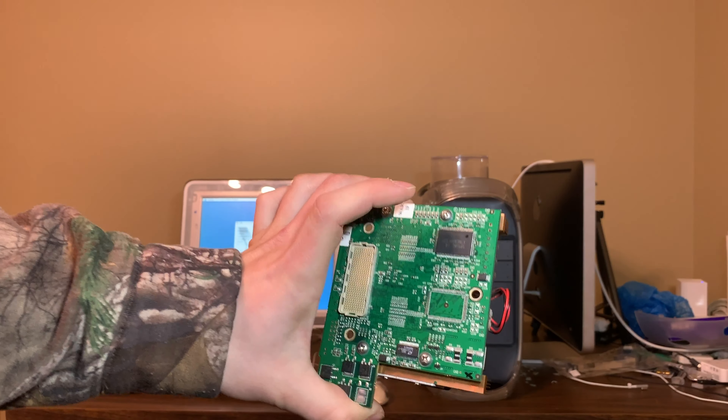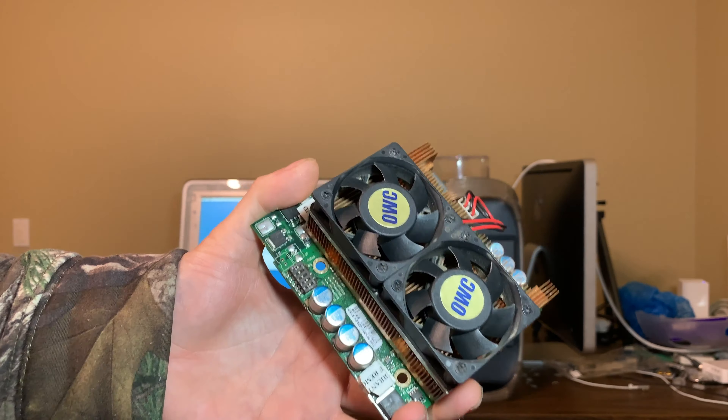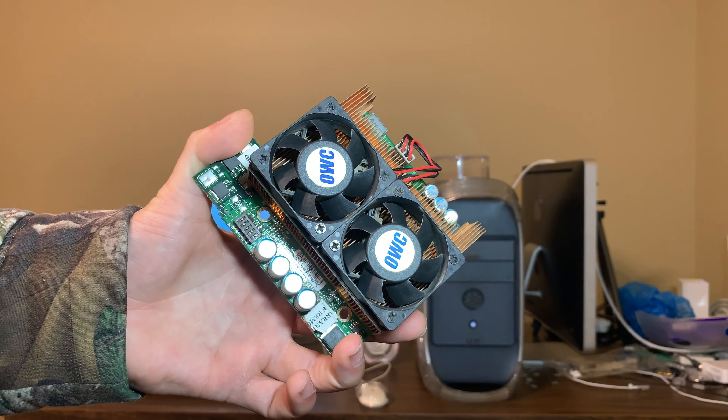This right here is going into the digital audio. At first I thought it was a dual when I bought it — it wasn't until later when I was looking at it that I realized it was a single, but I still got it for a good price. It's going to be a very fun video and in fact I'm going to attempt to overclock it. The problem is the next multiplier speed pushes it up to about 1.6, which it probably won't even post with. We'll see because you can actually control the clock speed with these jumpers right here by just turning them on and off.